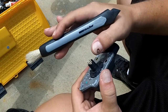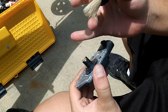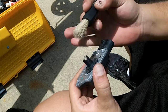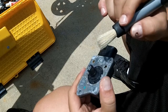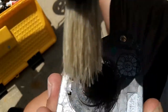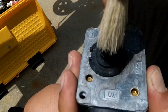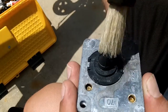So get a little brush like this — I got this one from AutoZone. This is actually pretty coarse bristle, so you might want to try and find something with a softer bristle. I don't recommend nylon because nylon is very hard. This looks to be like horsehair — try to find something that's a little softer. It'll take you more time, but the chances of disconnecting that wire are high — it's barely on there — so just go really light. Feather touches; it might take you five or ten minutes. Just choose a day when you have some time, Saturday or Sunday.